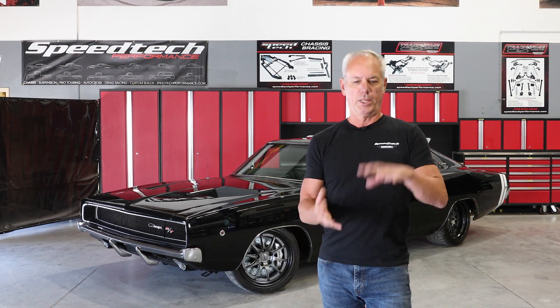Tom also wanted the subframe removable — maybe it's a little bit his own preference — but he wanted it removable for engine install. With these cars, they've got welded front sheet metal, inner sheet metal, the welded-in core support, unlike a Camaro where all that stuff unbolts. It's just a lot easier to do the engine install if you can remove the subframe, put the engine, the transmission, and all the parts and pieces on it, then lift it back up into the car.